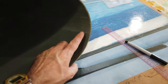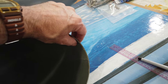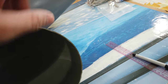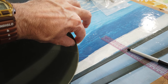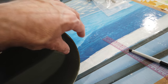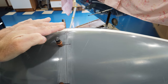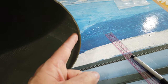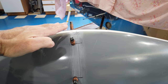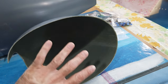At the top here there's some reinforcing fiberglass at the very top where the two pieces come together and are reinforced. This gets a little thick — it even talks about this in the instructions. So on your finished piece it might sit a little high here and you'll have a step. You can work that out simply by sanding underneath here to thin this out just a little bit so that this piece will sit down nicely. This front half is the piece I use to do everything — all my trimming — to get it to fit.